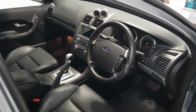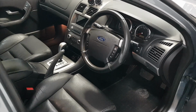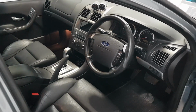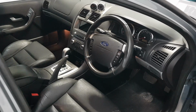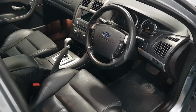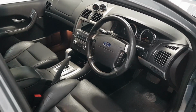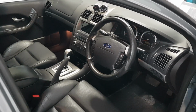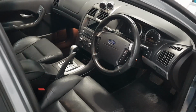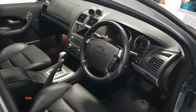And overall, if you're trying to make an NA gearbox work in one of these cars, or even a turbo box for that matter, I think it's something wise and worthwhile looking into. Now, I don't know long term if this is going to have some other kind of effect on the transmission, but it's no secret that these BTR 4-speeds in their stock form are not a very strong gearbox, and anything much more than stock power out of a turbo motor is too much for them, and they pretty quickly start slipping and having issues. So in my mind, anything we can do to help them and prolong their life a little bit longer is a good thing.